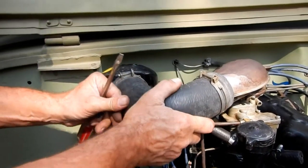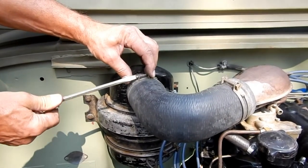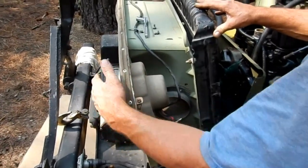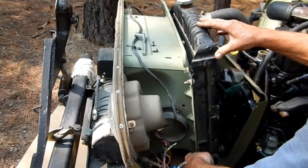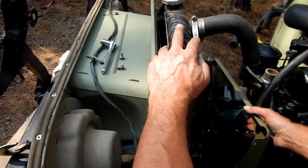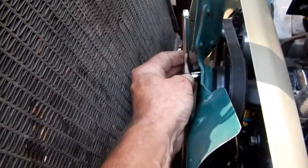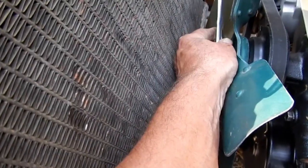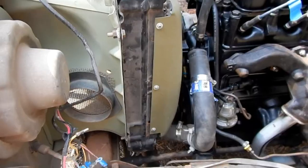I custom-made this out of a radiator hose since the original was shot and the replacement they sold me lasted about three months before it cracked — poor materials. We've replaced our grill and radiator assembly all in one piece, making sure to get the big rubber washer underneath on top of the crossmember frame. I've put my shroud on behind my fan, just letting it sit there so I can fairly easily access the fan bolts. There's still plenty of room in here.